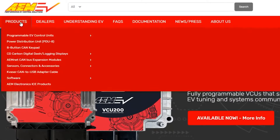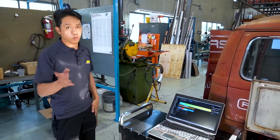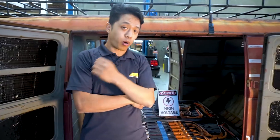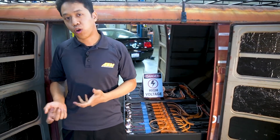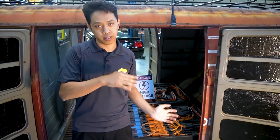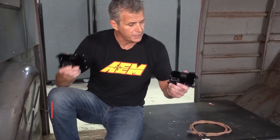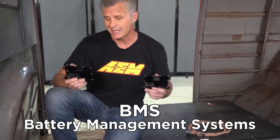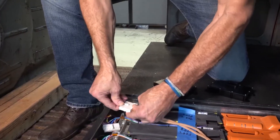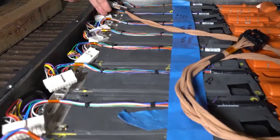I recommend you go out there and download the software — it's free, we don't charge anything for it. There are sample calibrations in there, check it out. Let's move on to the battery and the state of charge calculations. Some of you probably know that battery voltages don't stay the same and change with temperature. Prior to this, state of charge was basically calculated off pack voltage. We're now also taking into account actual battery temperatures, because as temperature fluctuates up or down, battery voltage changes accordingly — so you don't want a falsely high reported state of charge when the battery's warm, or falsely low when it's cold. All that information is coming in through the AEM BMS systems, which reports battery temperatures and individual cell voltages.